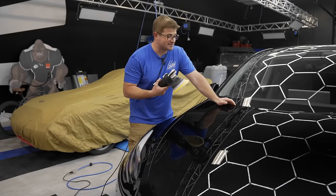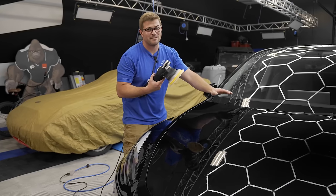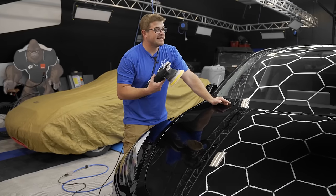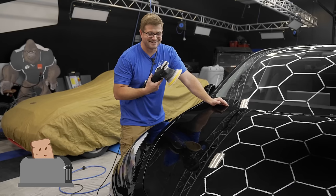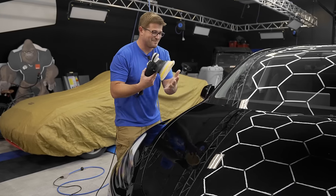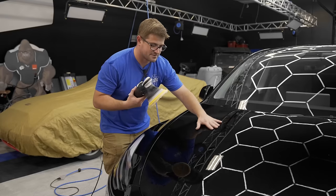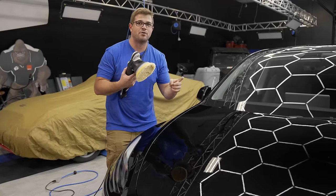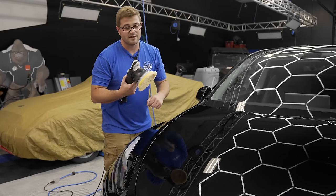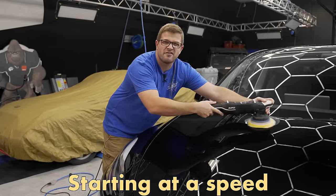Now there are a couple of reasons why I'm working pretty fast. First, the owner of this Tesla is coming to pick it up in literally an hour and a half, so I need to have this thing done. Also, it's about 85 degrees in the studio today because it's 105 outside. With the pad primed and ready to go, I take a look at the surface to make sure there's no other contamination. It feels pretty smooth, especially after claying. There are water spots on this car and they are semi-etched, but we're not going for perfection — I'm trying to extract as much gloss and slickness as possible. I start at the midpoint of the hood at a speed of roughly three.